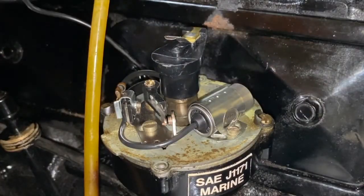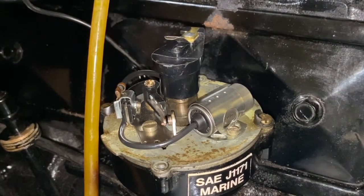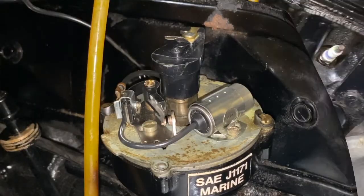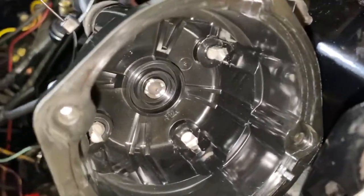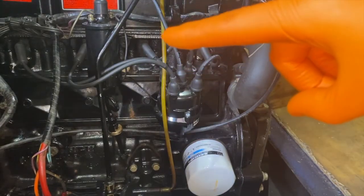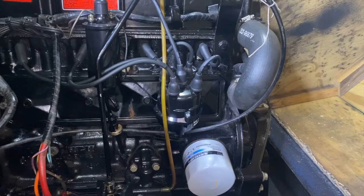I'll grab the feeler tool and check it one more time. I like it. Next, I'll go ahead and cut the zip tie and lower the distributor cap back onto the distributor and plate. Align the screws — both silver or chrome and the port side brass or gold — and tighten them in place. Coming up top and to the inner portion of the distributor cap, there are all the contacts as shown there. The distributor cap is re-secured on the top plate of the distributor itself. Just double check that all of your spark plug boots and wires are properly secured on both the top portion of the distributor cap, as well as the respective spark plugs that feed inside the engine. Also, that center wire or boot that feeds all the way up to your ignition coil — make sure both of those connections are properly installed, secured, and not loose. And that is how you set your gap for the internal point inside your distributor cap.